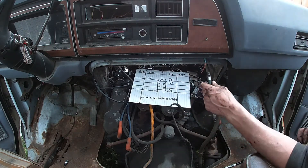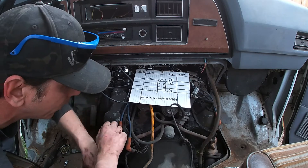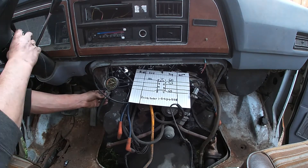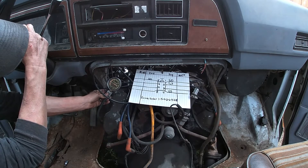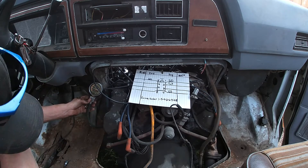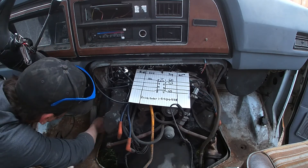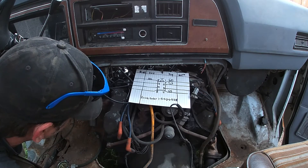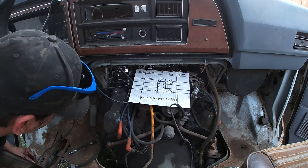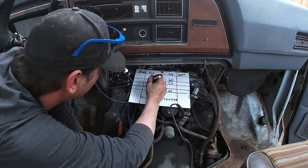So number six — that's the second one up over there. This is number six. See how that one shot up right away? Rings probably aren't too bad in this one, but again looking at bad valves — probably a worn cam. I'm only guessing, it's a possibility. We're going to call that one 62. That was 62.